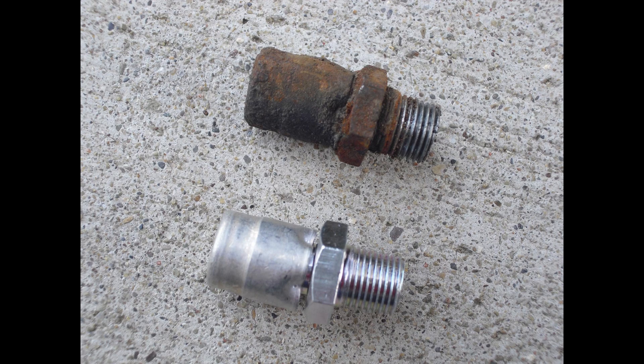This might not be something that you're aware of, but there is a very tiny part on the back end of the truck that can be a lot of trouble. Both the Dana M226 and the C200, which is the lighter duty axle, share the same vent characteristic — to allow air in and out of the axle housing, the pumpkin, when atmospheric pressure changes or the temperature inside raises and lowers pressure inside the axle.